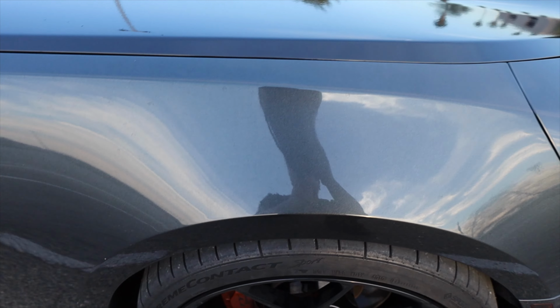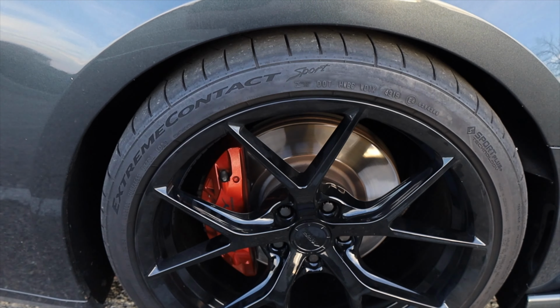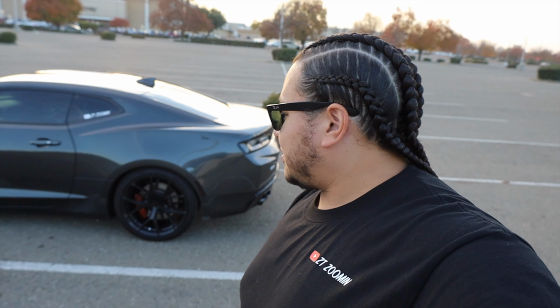Another thing to be conscious of if you guys are going with these wider wheels, pay attention to your offset, because if you get your offset wrong, your brakes will not fit in there. And if you have 1LEs, you have bigger brakes. So you've got to be a little bit even more careful. Also, if you have a 1LE or ZL1, these springs will work on your car too. So this is for all Camaro 6th gen platforms. This will work for it, including the V6s and inline 4s. I'll make sure to put all my specs down below in the description so that you guys know the exact setup if you want to do it.